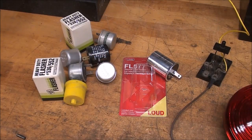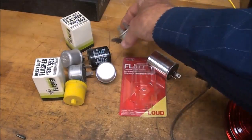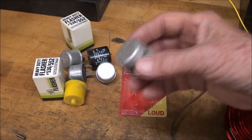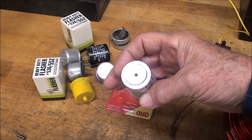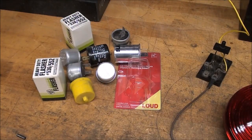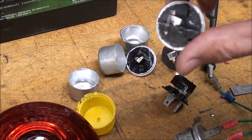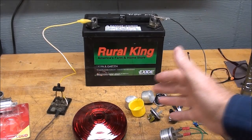Here's a selection of flashers I've had sitting in the garage. You'll see them in all varieties, but most have two prongs for American cars and are usually a little metal can — that's what helps echo the noise and make them loud enough to hear. Some are plastic. This is the loud one I bought but it didn't work on that other car; it has an extra-large canister. I've taken several of these apart. These are thermal flashers, and I took the covers off several different ones to examine them. Even though they're different manufacturers, they seem similar in theory.